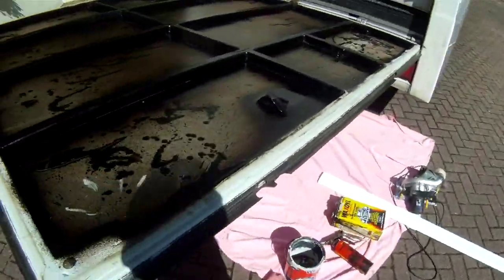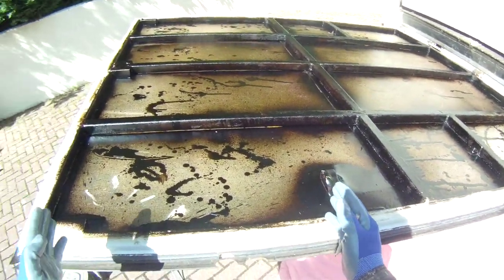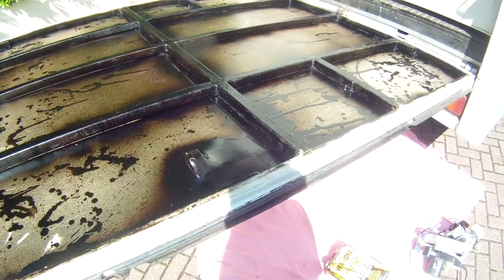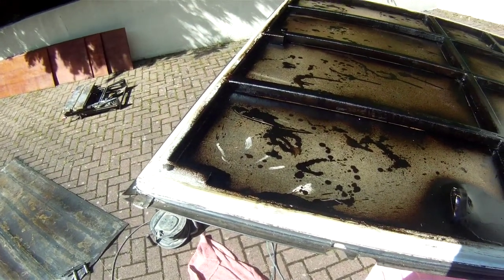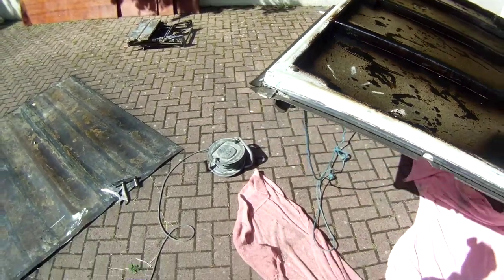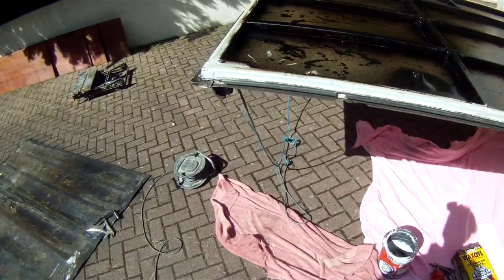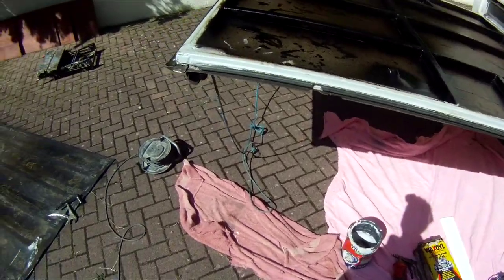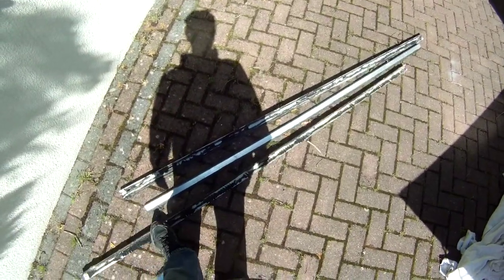So the next thing is to cut it to size, and I'm going to fit it lengthways across the metal structure, screw it down onto the metalwork, drill some holes first, then insert the screws and cover the whole area. And then after that we will re-glue the rubber back on again with some urethane glue, and screw that down as well, and clean up and put the metal edges back on, which are these things over here, which were stripped off.